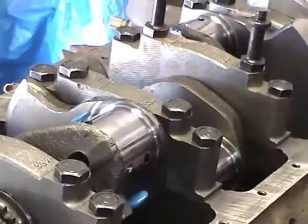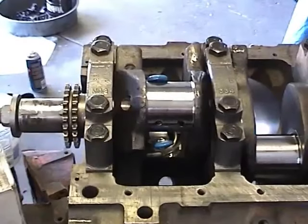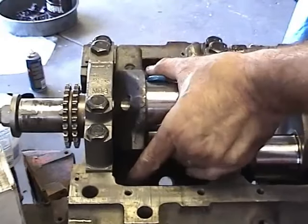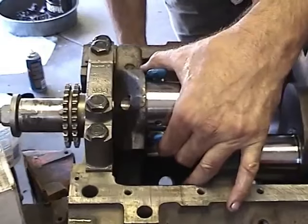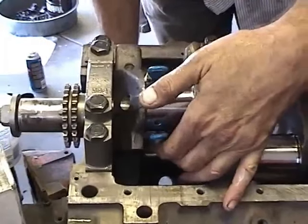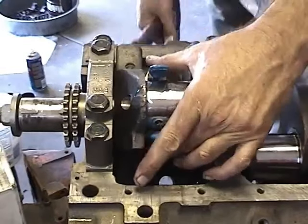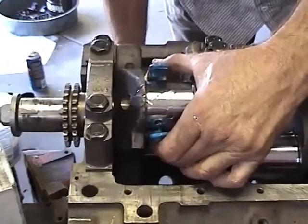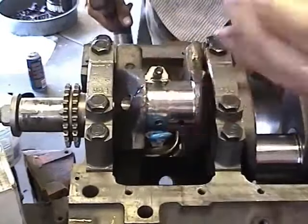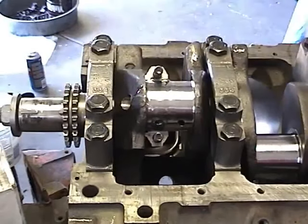What I'm going to do here is guide this with my fingers looking straight down it. We're looking straight down the crankshaft. It's a little bit cockeyed, so I'm going to hold onto it — you don't have to muscle it, just barely turn it with your fingers as you're tapping and it'll move. Try to get it on there as straight as you possibly can, continuing to tap while guiding it so it doesn't bind up on anything. And there we go — attached to the crankshaft. Remember to put a good amount of assembly lube on that bearing and the crankshaft before you put this together. It's really important.